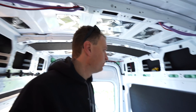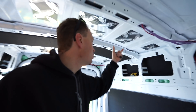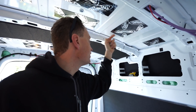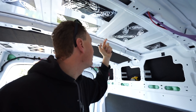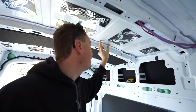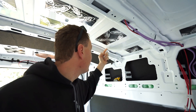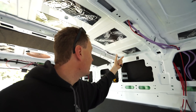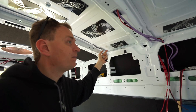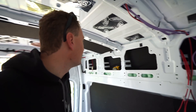I've been trying to figure out where to put this hole in the roof to feed the solar cables through. There are a few issues. We need a decent width of flat piece of roof, and the only real flat bit is around this part here. This isn't quite wide enough — it's slightly curved here, then there are ribs here, and then this flat bit here which would be quite good. But it won't fit underneath the rail for the solar panels that's there.